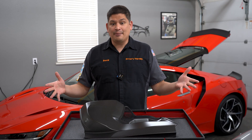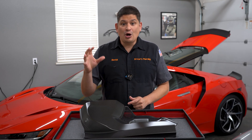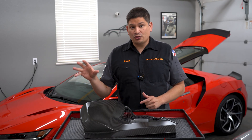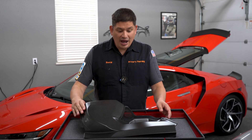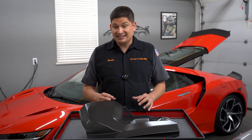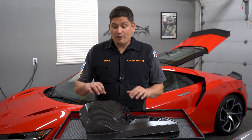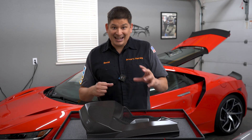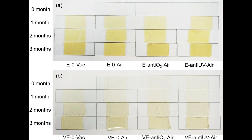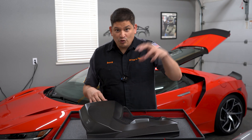Why does it happen? Well, you have two main factors. One of them is UV degradation, and then you have resin oxidation. Whenever you have a panel, you have carbon fiber — typically not a solid piece — and then you have a resin and a bunch of clear coat on top. That resin, if they don't take into consideration the heat, starts to oxidize and turns yellow. When you have a poorer quality clear coat and UV starts to degrade it, it typically starts to show more of a whitish, dull color.